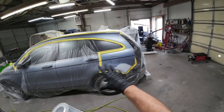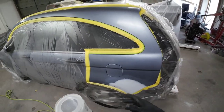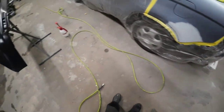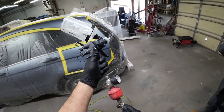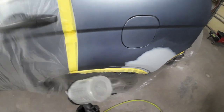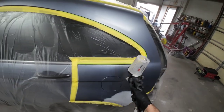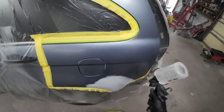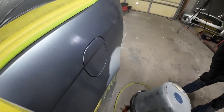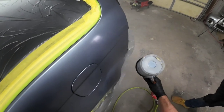I've got the sealer all mixed up, but on this quarter panel I want to go ahead and lay down a wet bed, or a clear base coat. A clear base coat has no pigment — it's just binder and reducer. What this does is lay down a nice wet bed for those metallics to lay in, helping them lay flat and uniform so we have a nice transition and metallic orientation. We'll spray it over the entire quarter panel, and then pretty quickly after, we'll put our base right over top. We want to keep as little paint as possible right up against that door for the first coat.